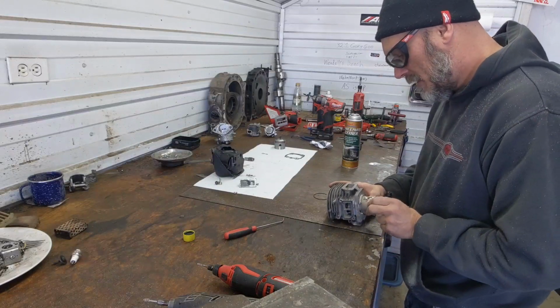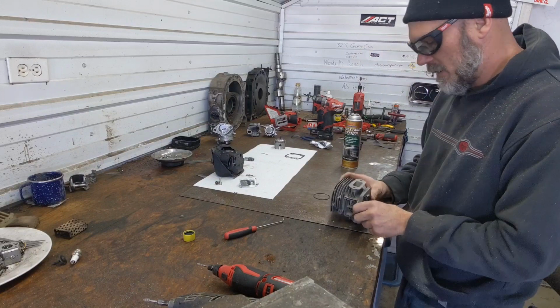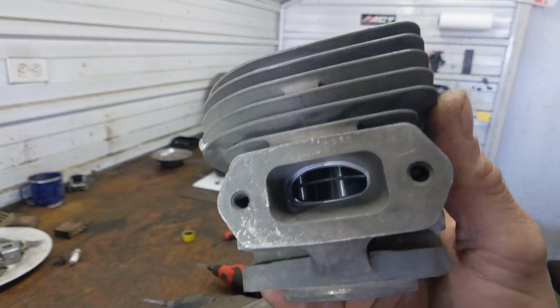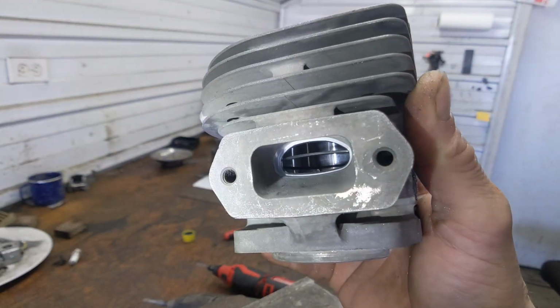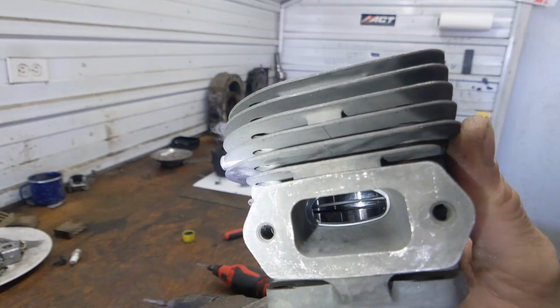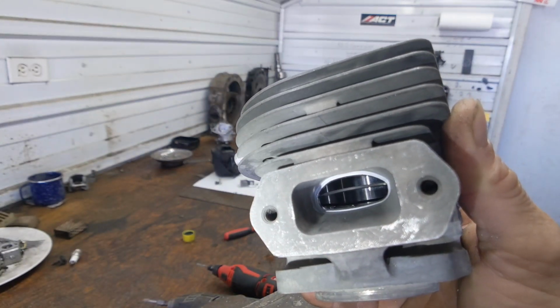They have time, but they don't have much area. I'll try to put that at the bottom of that curve so you can see. So they have the time at about 106, but they also don't have much area. See how much curve there is to the roof of that exhaust? And on the piston, there is a ring pin locator on the exhaust side. You would have to go quite wide to get into it.